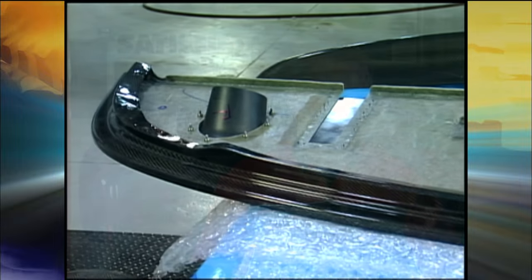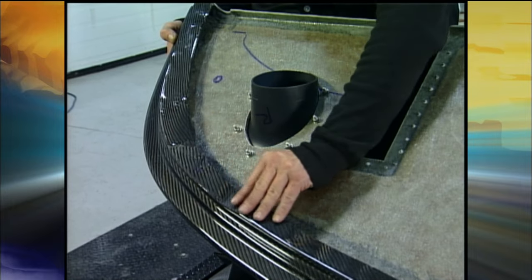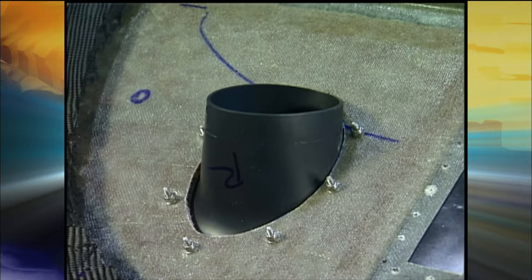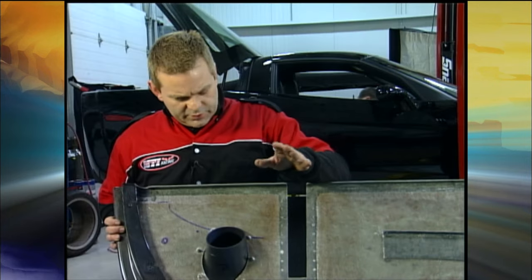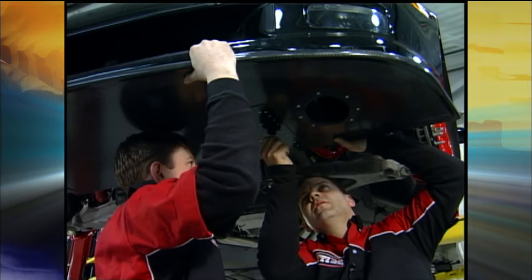We came up with a two-piece carbon fiber aerodynamic package — awesome. It takes the lift count from 220 counts of lift to 240 counts of downforce, a change of 460, at a penalty of only 40 counts of drag. That's 460 downforce versus 40 drag — like an aerodynamic free lunch. The carbon fiber front splitter follows the contours of the OE factory front fascia, bolting right up in the stock location. Brake ducts are built into the lower portion of the front skid pad, and aluminum billet hard points let it bolt to the lower frame and take a few whacks without ripping off.